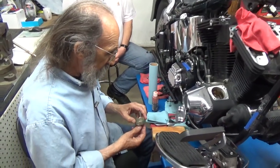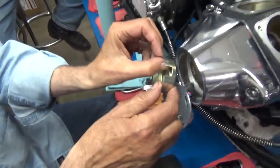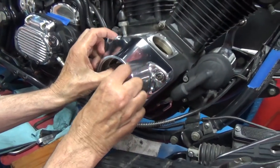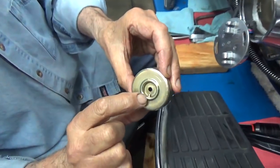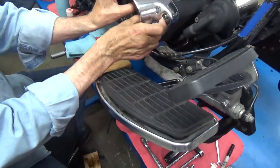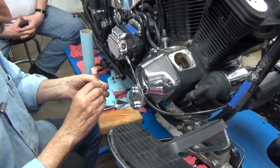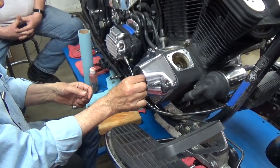I'm going to put the ignition parts in here. This is the cup that times your electronic ignition and it goes right here on the end of the cam. There's a little — I don't know whether to call it a detent or what to call it — that little gizwhiz right there actually times itself on the end of the cam. So you want to feel it in place, make sure it's nice and home before you put the screw in that holds it.